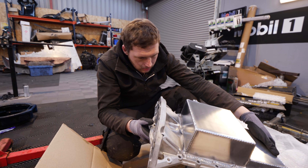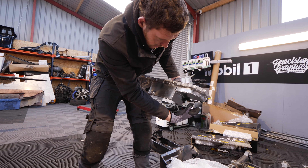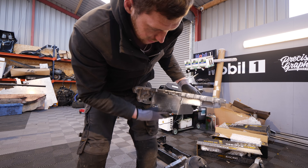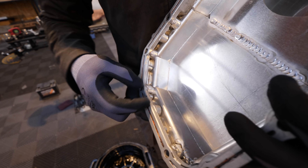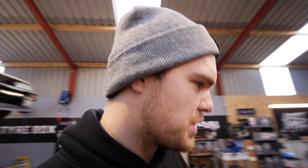I'm not going to lie, I'm not even going to pretend I even know slightly what I'm talking about. I know that the pot thing's been moved to the back and that is about it. That's very nice welding. It's relocated to where the old standard sump was. Yeah, and it was hitting your steering rack and your anti-roll bar. So the idea is now that we can get the steering rack and the anti-roll bar here, and this will sit down below the subframe. So it should fit. The next job is to get this onto the engine, drain all the oil out of it, and then we can get the sump fitted and put it into the engine bay to get more of an idea of how it's actually going to sit. Let's get this fitted to the engine.